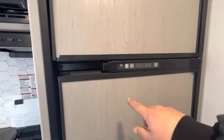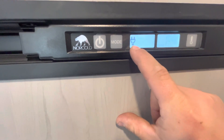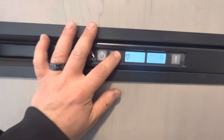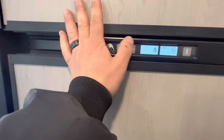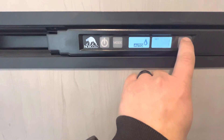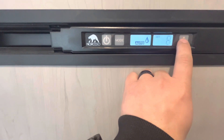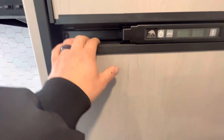Your fridge — pretty simple. You've got your power button there and your mode button. The power icon is looking for when you're plugged in electrically. If you hit the mode button it'll go to the little flame icon and light on gas. Then you have auto, which will look for electricity first — if you lose power overnight it'll automatically switch to gas. You've got your temperature set right there: one is not so cold and nine is the coldest. You push down on this latch right here to open the fridge, and then the freezer.